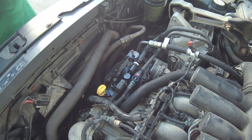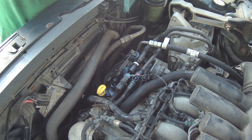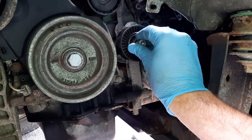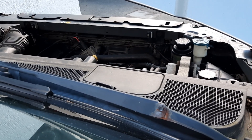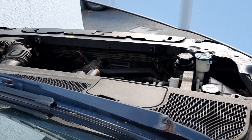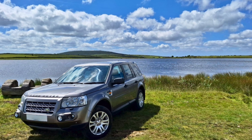Once that's done it's time to reconnect the temperature sensor. Now if you've got this far and realise you forgot to take a picture of the fan belt routing, here's a picture of how it all goes. This is the idler gear, which is a bit of a fiddle to do one-handed — that goes back in place. There's a plastic cap that goes over to protect the nut. Once it's started, I'll hold the revs up at about 2,000 rpm for a while to get the worst of the air out, then let it idle. Here you can see it's idling nice and smoothly. Prior to the change of the pulley this belt was jumping around all over the place, which is a good indication if that's what the problem is. I hope you've enjoyed this video and it's got your car fixed.